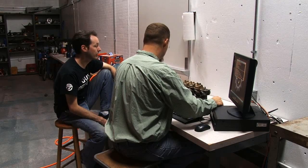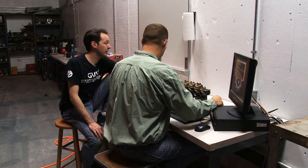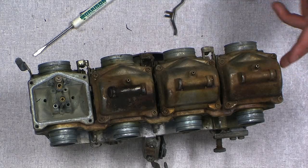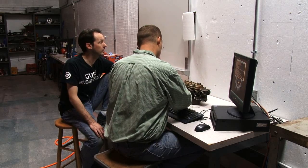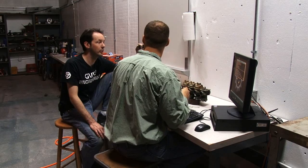So the motorcycle, like this is the fuel reservoir, these bowls. Right. And this is designed to keep a constant level of fuel in there as you need it. Right. So it's gravity feed down to this, and this is where it sucks from. It sucks up under negative air pressure. Exactly. Okay. That's kind of neat. So these always just float. It's an automatic level sensor.